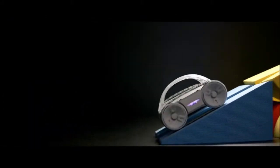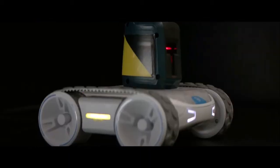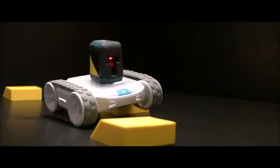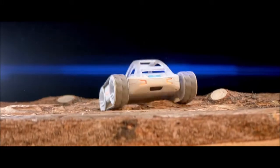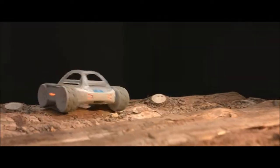It's got all-terrain capabilities. We've got high-torque motors with a high gear ratio, which allows it to go fast but also allows it to go really accurate at slow speeds. If something disrupts the treads or if one tread moves at a different speed than the other, it'll still go in the heading you originally intended — which is something you need for tank-treaded vehicles. The driving experience is unlike anything you've ever seen before. We worked really diligently to make sure this gearbox was robust and that every single gear tooth would be able to withstand mulch or rocks.